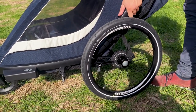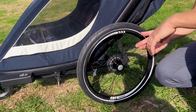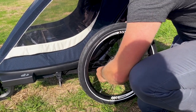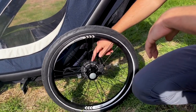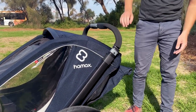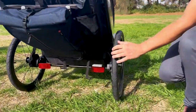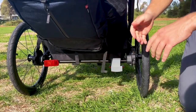You can see now that for the same amount of effort the suspension is more compliant. So depending on the weight of the riders and the conditions you're travelling over, you can adjust it to suit your needs. Additionally, the Breeze is fitted with two band style brakes, which are controllable from either up the top through this handle, or from the back with this pedal, which acts like a handbrake.